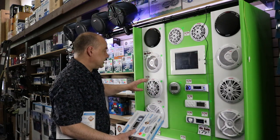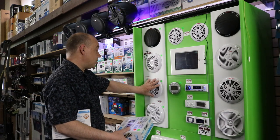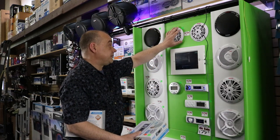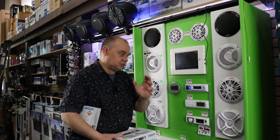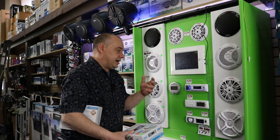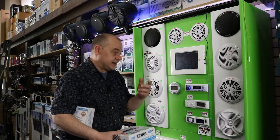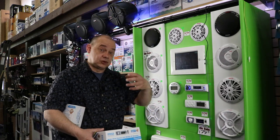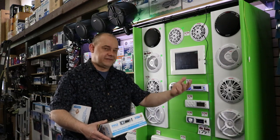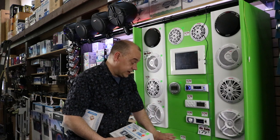You could be selective and get the PLMR62s — the 6½ — or the 52s, the 5¼. Those are two-way, very high-efficiency speakers, which means it takes very little power to get them to sound really good and you do get a lot of volume. A high-efficiency speaker has a downside though: I don't want to put them on an amplifier, because they reach their top end pretty fast. They're really good for head units, not so good for amplifiers.